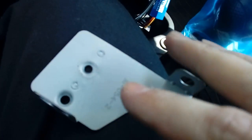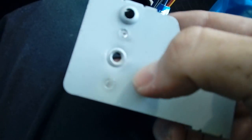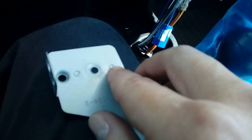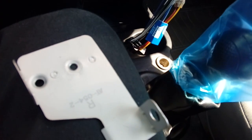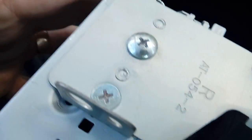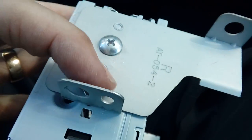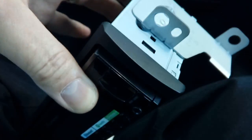As a quick side note: depending on what radio you fit, you may have to beat these little lugs flush — they stick out and make the thing not line up properly. On this particular one I've had to beat both those flush and also this screw, so it sits nice and flush on the radio. You'll have to line it up yourself and see which ones fit and which ones don't. It fits nice and flush up against the metal bracket — one countersunk screw and one flat one. These screws normally come in the packet with the radio if you buy a Pioneer, Kenwood, Sony, JVC, etc. If not, you'll have to find something similar as the original screws will not fit.